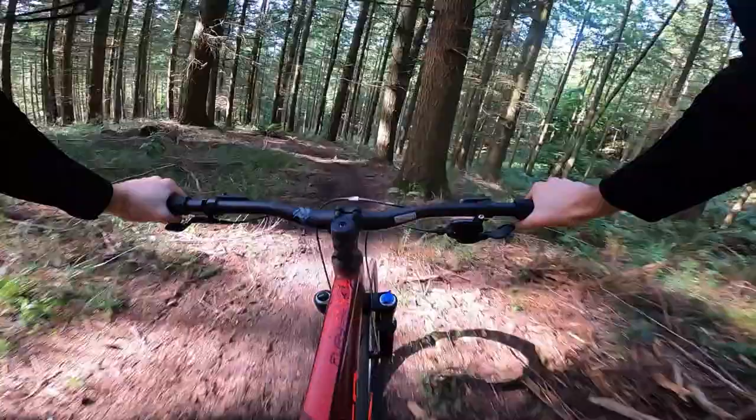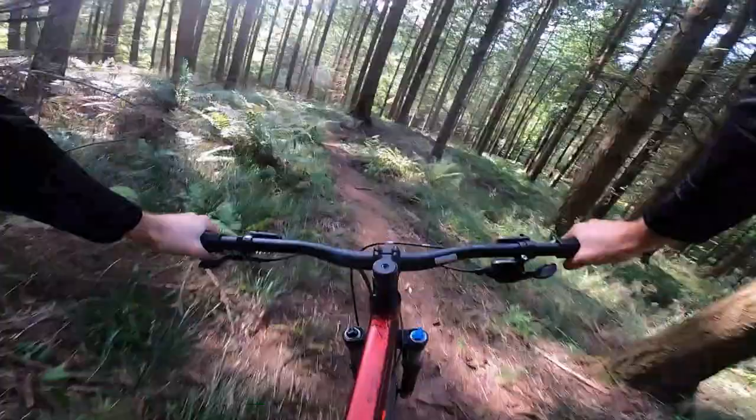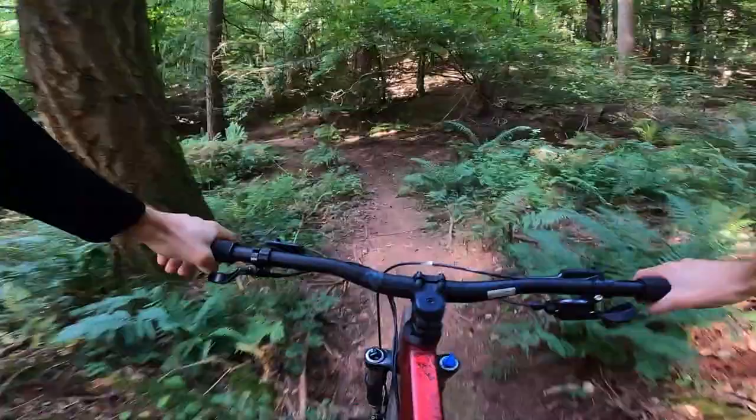They aren't tubeless, which is on the downsides, but again, 600 quid — you can't really be whinging too much. The air fork is very impressive. It's not mega supple or particularly subtle in the damping, but it's doing the job — I'm not getting beaten around too much. And unlike most bikes at this money, it's air sprung, so you can alter it for your weight.